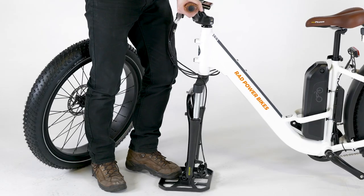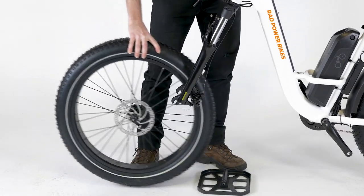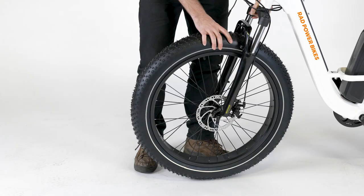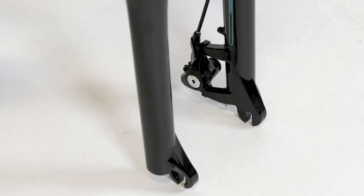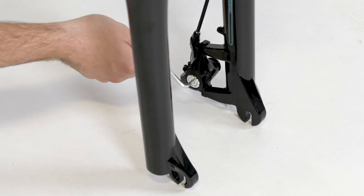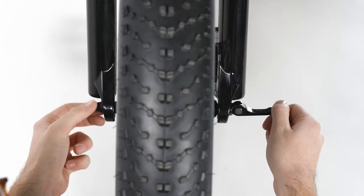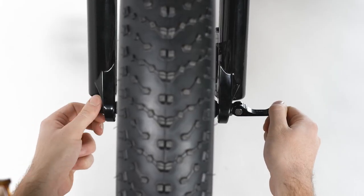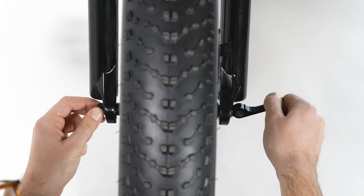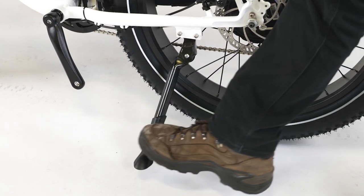Make sure the lever is open, then carefully lift the front of the bike, remove the protective plate, and lower the fork onto the wheel. The brake rotor should go into the brake caliper in between the brake pads and the axle should enter the fork dropouts fully. If installing the front wheel is difficult, use a 5 millimeter Allen wrench to widen the gap between the brake pads by turning the inner pad adjuster out or counterclockwise two clicks. Check that the wheel is fully seated in the dropouts and that it is centered. Hold the quick release lever in line with the axle and tighten the thumb nut on the opposite side until the lever can stay parallel to the floor without being held. Then use the palm of your hand to close the lever without touching the brake rotor. There should be enough resistance that the lever leaves an imprint on your palm. Prop the bike on the kickstand.